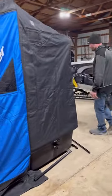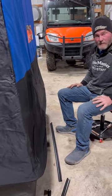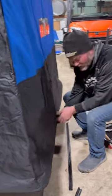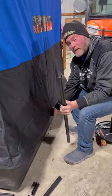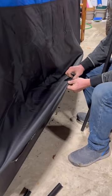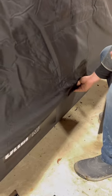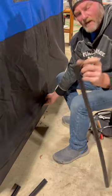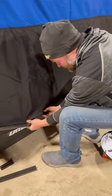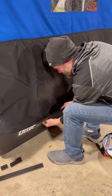So I'm gonna show you something — we're gonna put the beadlock on and I really wanted to have a camera for this part because a lot of people make the mistake of pulling their canvas super tight and putting it underneath the tub and then putting their trim lock on. I don't do that. You can see there's a hemmed edge on this canvas right here. All I want to do is put that hemmed edge under that lip. You take your trim lock with the 45-degree angle side — that goes in — and you just work it along.